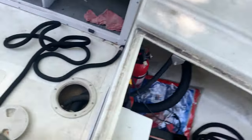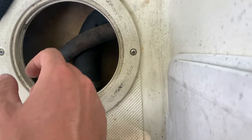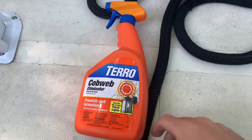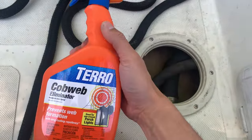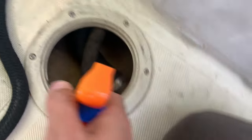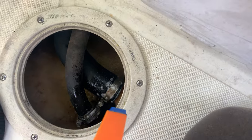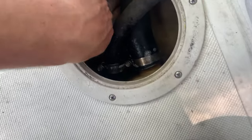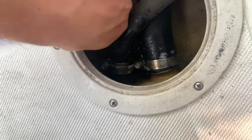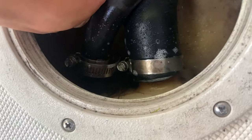Back here you get to these fittings. To double check that they were sealed, I used some cobweb remover — just kidding. I emptied it and put soapy water in it. What soapy water does is, if you spray it around a fitting, the soap will surround that fitting. With these fiberglass tanks you can press on them, and when you press on them air fluctuates inside the tank.